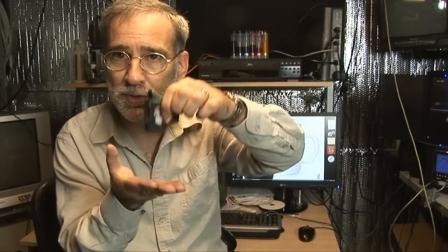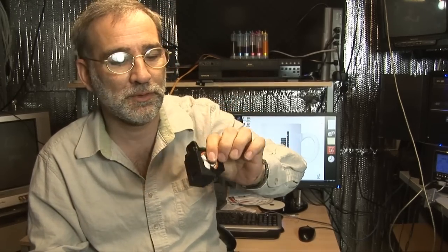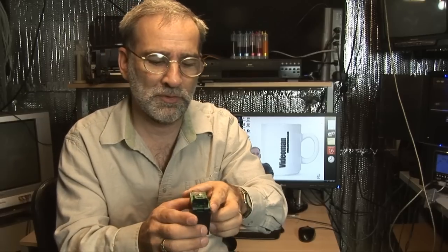The old tried-and-true method is taking a piece of paper towel, putting a few drops of water on it, microwaving it for 20 seconds, then taking your cartridge, putting it on the hot wet paper, and dabbing it. This will draw the ink out. It works wonderfully because these cartridges are just too expensive to throw out when you can still get another 100 or 200 discs out of them.